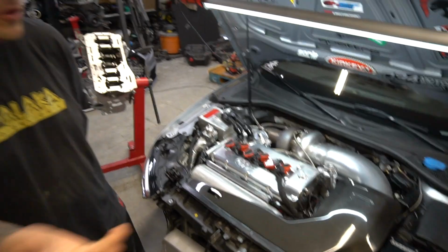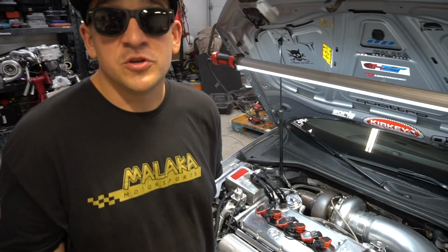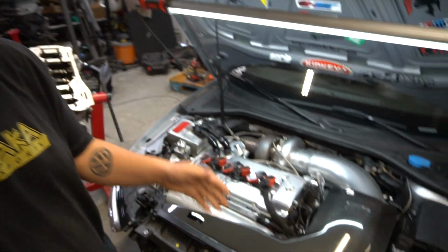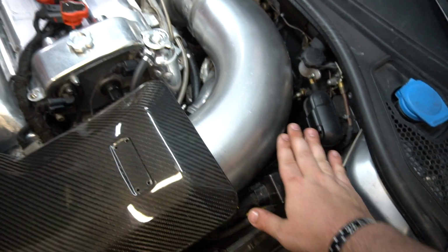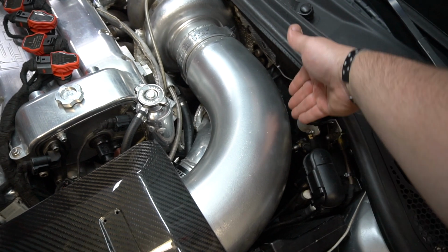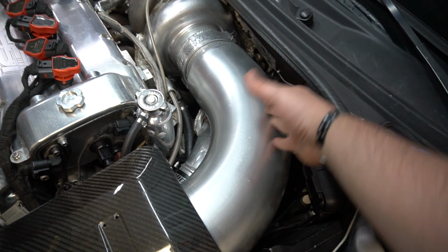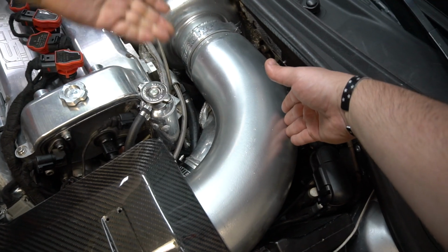So one of the things we're going to talk about, George wants the ECU in the glove box. So now we're going to remake the harness, and let's show them the actual ECU. In the 5-cylinder setup, even in the VR6, we pretty much left the ECU exactly where it was. In fact, with the 5-cylinder setup, the ECU was mounted right here, down to the little plastic mount, about 15 inches from your exhaust manifold.